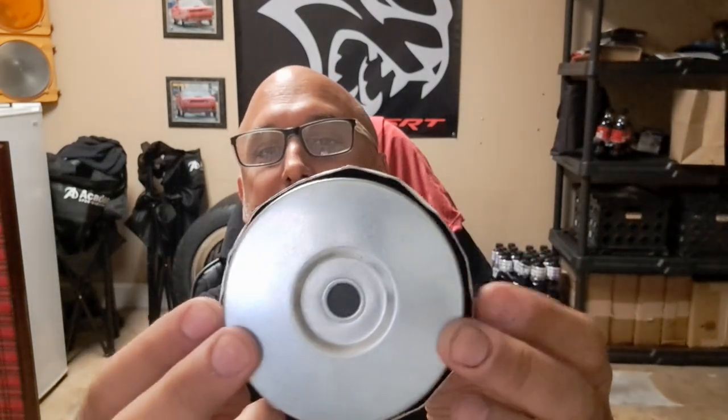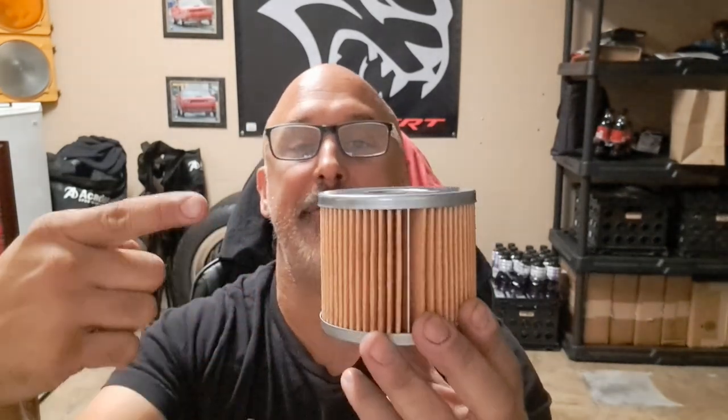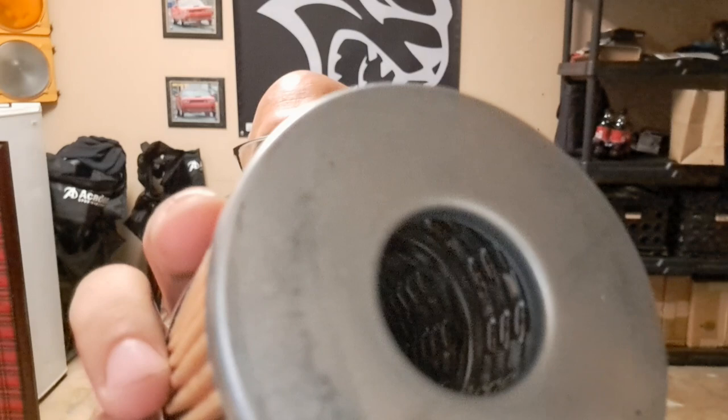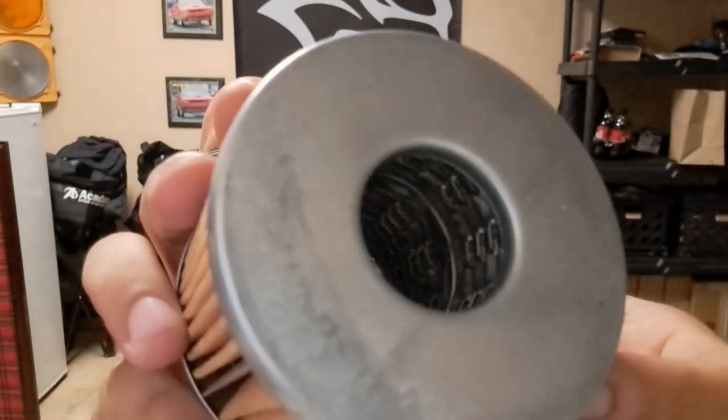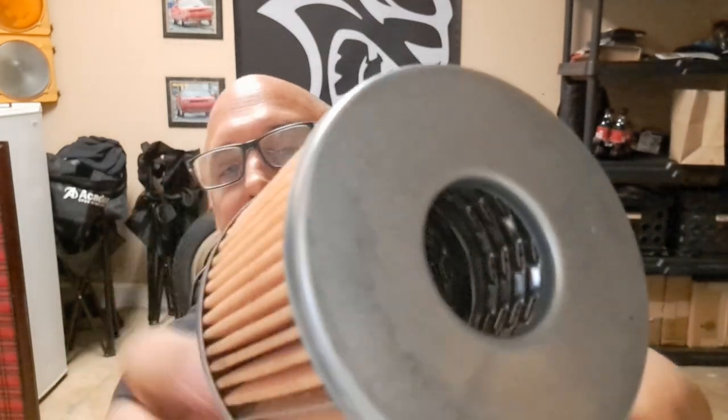But at any rate, the way that this can work, you can imagine that the sides of the case are actually holding the pressure in, and that pressure only has one place it can go to get out of here, and that is through the actual media and then out the return. And if you notice, inside of there, part of the body of that thing is actually these little cuts right there in that metal. That's where the oil returns into the return side and out. In this case, it's actually in the direction of oil flow, which is kind of neat.